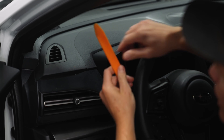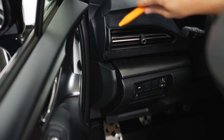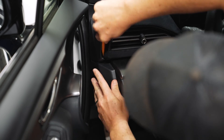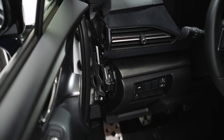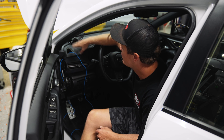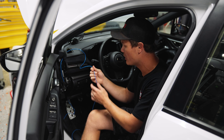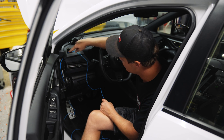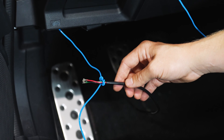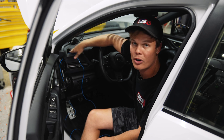Now I'm going to use a trim removal tool and gently pry out the vent on the dashboard. Pry off the side panel next to your vents and that's going to give us access to run our harness. I devised a system to get the wiring harness from down by the pedals up to the vent where we need it for the new gauge — I found some bright colored electrical cable, ran it through the dash by popping the side panels off, tied it to our new harness, and now I'm fishing it back the same path so the harness ends up where we want it.